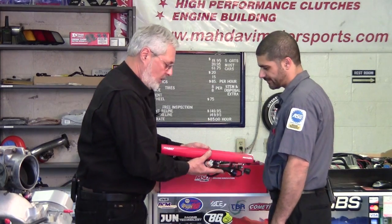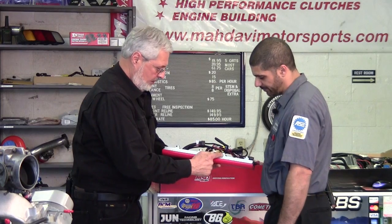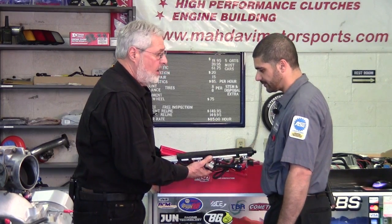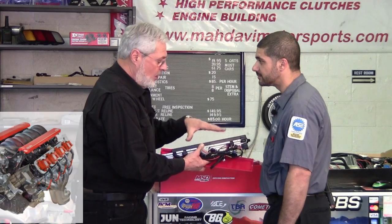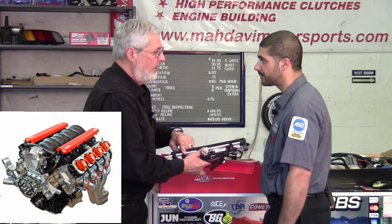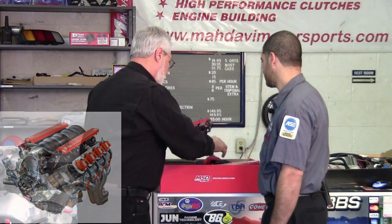Now, here's the first thing you get. You get 2 of these that go along the top of the engine. Right. These are actually your fuel rails. Look at that, they're billet. Yeah, it's all nice billet, machined well, but here's what you've got. The computer is split into the 2 fuel rails and mounted right there. Look at that. Yep, and the side benefit of that is your electronics are in here, and the fuel going through the rails cools the electronics. That's very cool. It makes it very nice and neat and easy.